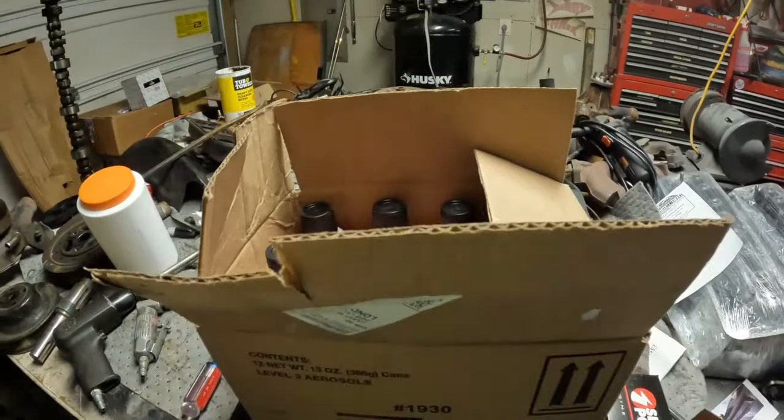Now's the hard part. All the bolts are out. You don't want to throw this backing plate. I have a tool that you can put on here and pry against this knuckle, but everybody says not to do that. South Main Auto especially says not to do it because what you'll end up doing is breaking these ears off and you'll have to buy the whole entire knuckle assembly. I have this weird tool made for rolling fenders - you bolt it to the hub to roll your fender lip so you can put big tires on lowered cars. But I've used it to pull drums off. It bolts on just like one of those flanges that you hit with a sledge. I'm going to try to bolt it in here and use leverage and try to vibrate this out.